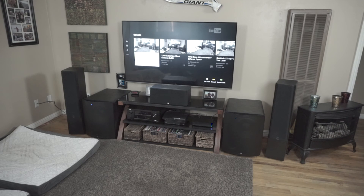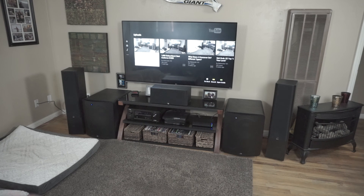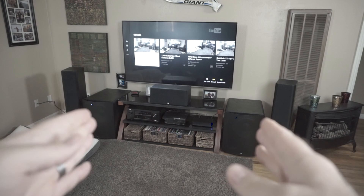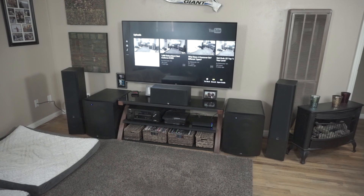My thing is go with something that's decent to begin with. Don't cheap out, because the people who go with the better subs can really hear the difference — it's pretty undeniable. Hopefully that helped you get set up. I had a viewer ask about this — he said he'd only got a 7.1 or 5.1 receiver and asked if he could still do this. Well, yeah, but there are some caveats. I thought I'd do a video on it. It's good to point out those things, particularly the variable phase settings — that can make the difference in whether you can integrate dual subs or not. If one sub is going to be further away, a variable phase dial can make it easier to integrate.